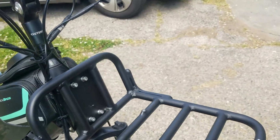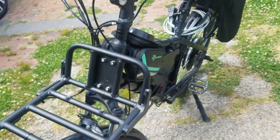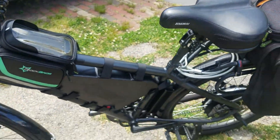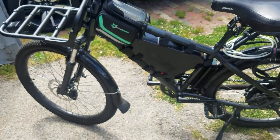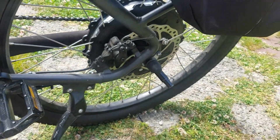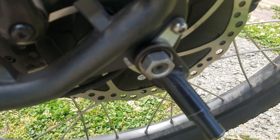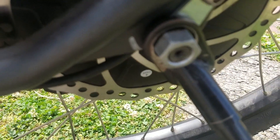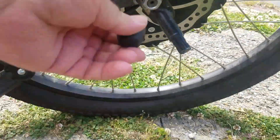I finally bought one of these big massive racks several weeks ago, and of course now they're giving a $50 discount on them. I waited two years to get it and paid retail, and never did get my discount for buying the bike. Of course, my trailer hitch — if you put a hitch on these, get rid of the flange nut, get a regular nut; it'll go inside the bracket and go just about flush to the axle. If you use the flange nut, you only get about half the threads in there.